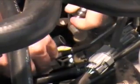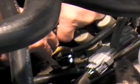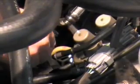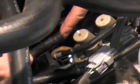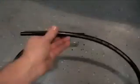There it goes. Next, with a compressed air hose, I'm going to blow some air through this line. That's pretty low pressure. So with the air hose, what I just did is I blew all of the old oil out of the transmission cooler back into the transmission. So I'm making sure all the old oil is gone. Next, I'm going to take my own length of hose and feed it up under the engine. There it goes. I'm going to plug it into this pipe here that I just pulled the old pipe off.